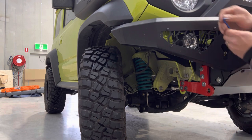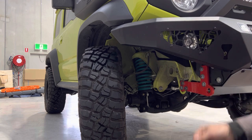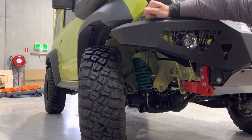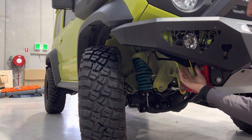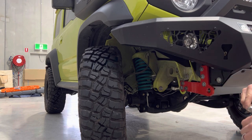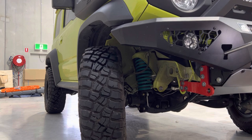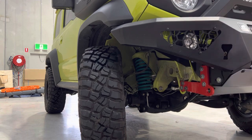We've tightened up the bolt on the top and the bottom. Use your Allen key around there and then put it all the way in and tighten that up. A cool little trick: we've put the M8 through there that goes in through the body — if you have a long extension, you can actually go through the high-lift jack hole without having to use a spanner.